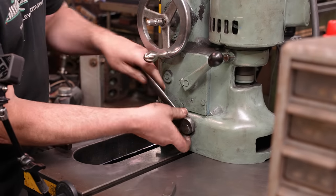Mike went ahead and assembled the rods and pistons. It's a pretty simple process: you take the small end of the rod, put it in the heater, and watch the temperature as it changes color coming up the rod. The bottom edge will be red, and just as the gray starts to get about halfway, he knows from experience that the rod is swelled enough. Then he puts the piston into the fixture, has a little push pin with a stop on there. He pushes the wrist pin into the piston and through the rod — which is swelled up — pushes it quick to the stop, and that's it. When the rod cools, it comes back to size and pinches onto the wrist pin.